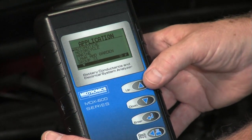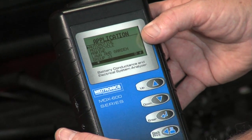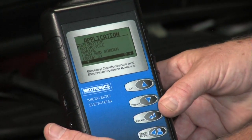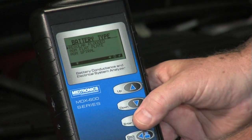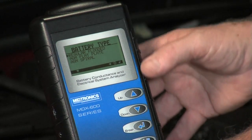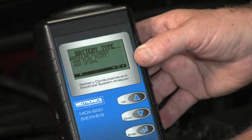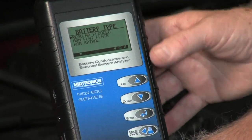Now it is an automotive battery. You've also got motorcycle, marine, lawn and garden, and group 31 batteries all shown in there, with individual algorithms for those appropriate values. But we're automotive — we are a regular flooded battery. There are also profiles for AGM flat plate batteries and AGM spiral, which are typical for Optima batteries and several others in the marketplace today.